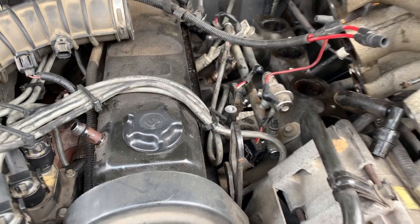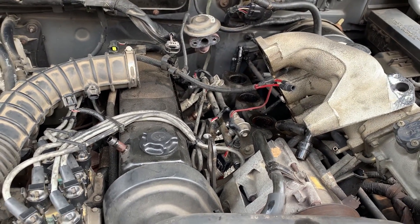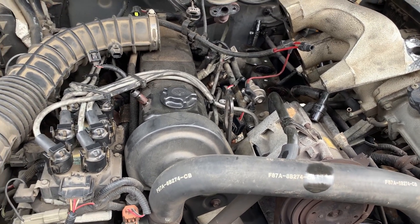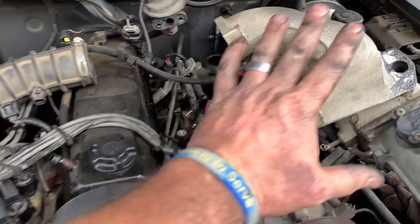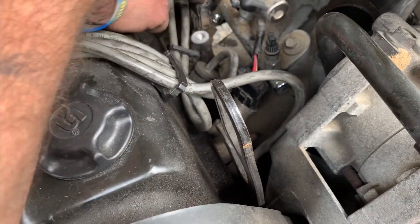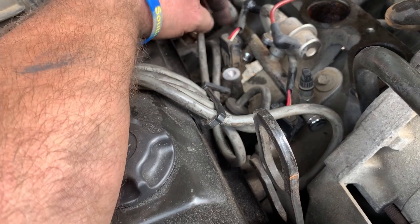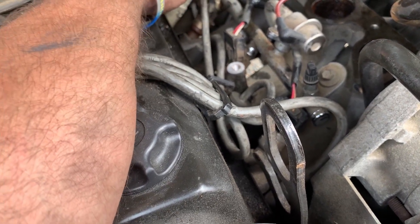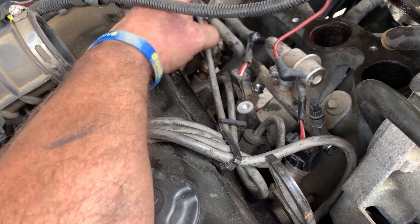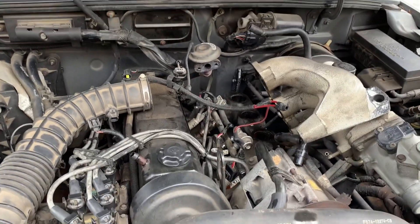Injectors are about $65 a piece — I found them for about $40 on Amazon. Either way, it's going to be $200-some dollars to put all four injectors in this truck. I wanted to verify 100% that that's what was wrong. I've taken the upper plenum off and slid it out of the way. We've got all the injectors here — one, two, three, and four. I'm going to swap probably four and one, since four was working and easy to get to, just to verify the diagnosis. If that confirms it, I'll have to order some injectors.